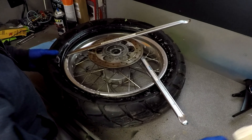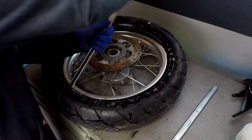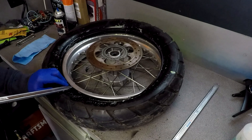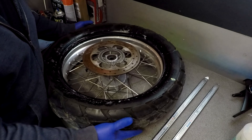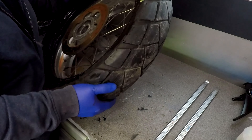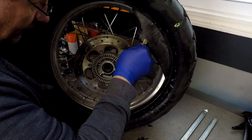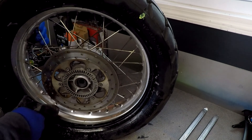This is a tough tire. If you're worried about damaging the rim, I recommend putting a rag in between the tire iron and the rim — I'm not worried about it. Once you get to this point, all you've got to do is take off one side, lift this tire out, and work that tube out of there. I like to start with the valve area and just pull it right out.